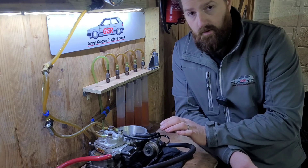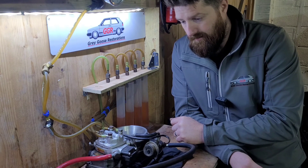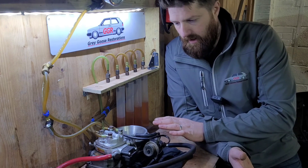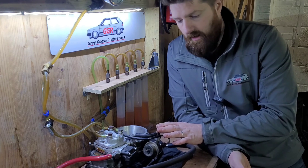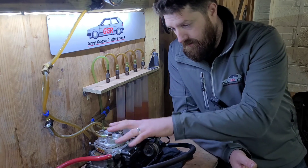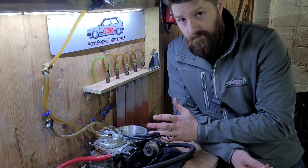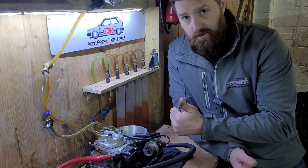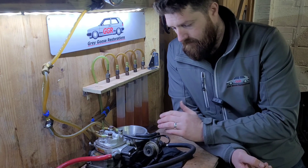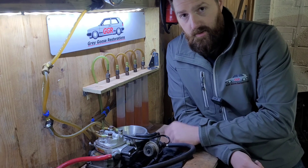It's a very complex system but the fundamentals are there. Once I've got that cut-apart metering head all colored in like we did with the other one, I'll go through it more slowly and show you where the fuel goes, how the EHA actually operates, and give you a better understanding like we did with the K-Jet. Thanks for watching — I thought I'd take the opportunity to show how to do system pressure on these. Remember: residual pressure, system pressure, and differential pressure — 0.4 bar is the perfect happy medium. See you next time!